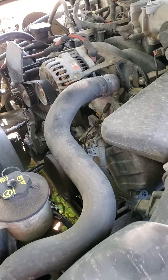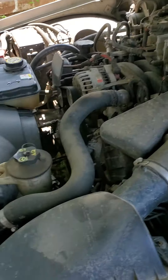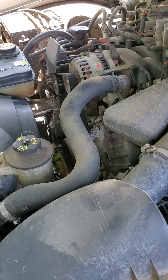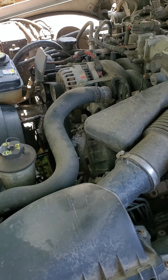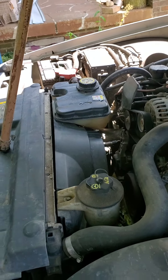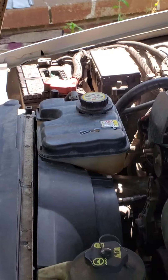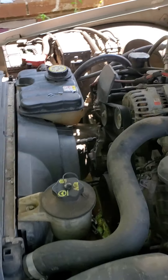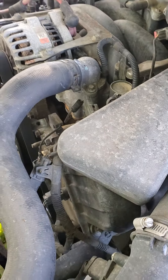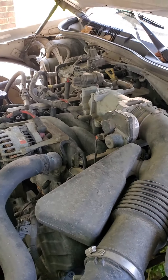So far it's holding. I did a seven dollar repair — Bar's Leaks Liquid Copper, it's a liquid glass product that you pour right into the overflow tank there, or the radiator. They said it's okay to do it in the overflow tank if you can't easily get to the radiator.